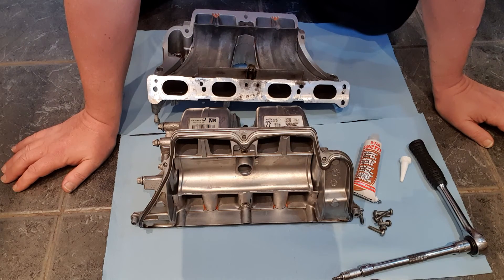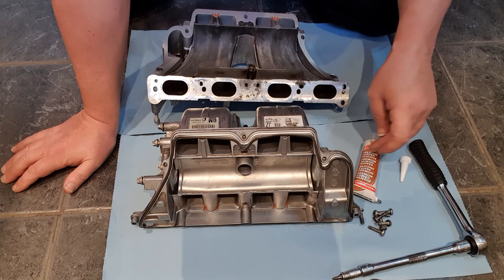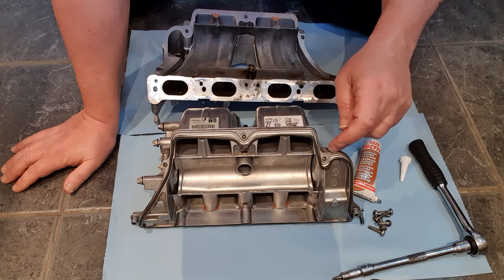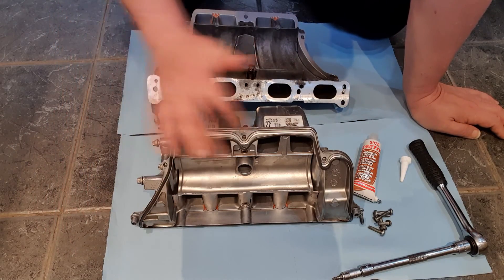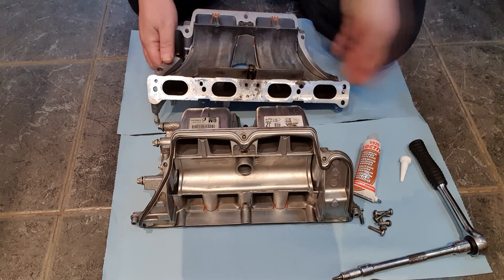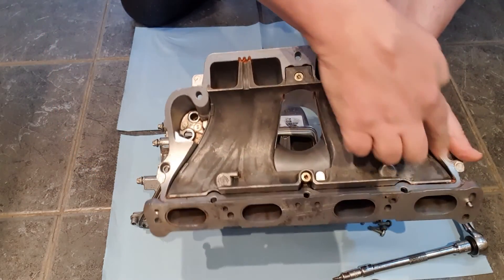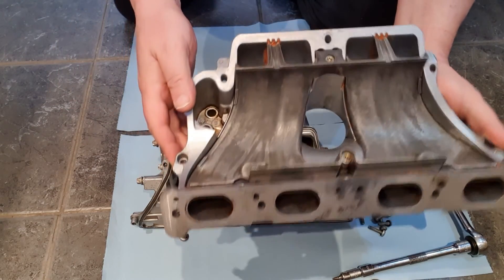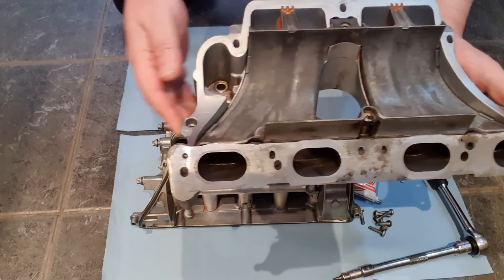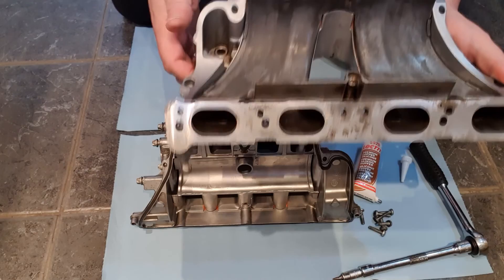However, it is a little bit loose in places. So what I'm thinking is I'm going to put a little thin smear of this copper gasket maker in the groove just to stick it in place, and then maybe just a thin smear over the top. Obviously it's going to mate with these surfaces here and here, so we don't really want a load of goo oozing out into the intake manifold. So just a little smear just to stick it in place and just to aid its sealing.